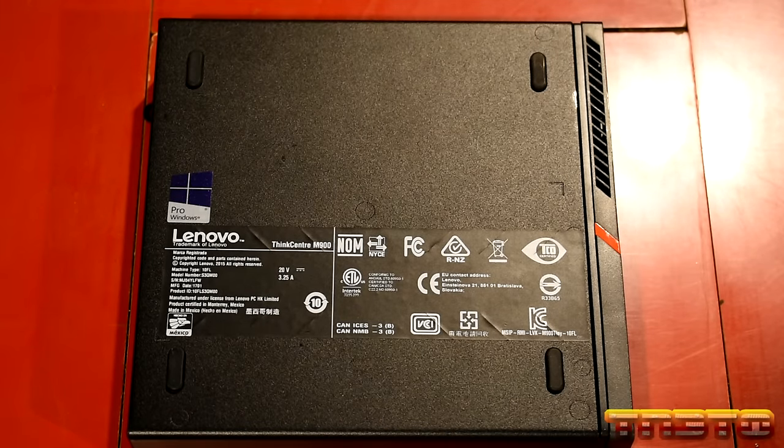Just keep hitting enter. Now, if you see this number down here counting down, you want to press enter to pause it. Otherwise it will just continue booting, okay? But see that number's not counting down? So this gives you various options. I like this. So escape just means, hey, just continue normal boot up. F1, go to BIOS. F10, diagnose hardware. Basically, Lenovo has a built-in UEFI diagnostics program where you can test various things, which we'll go ahead and check out.